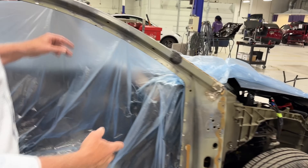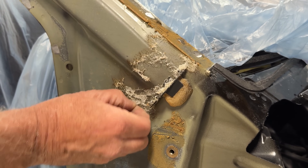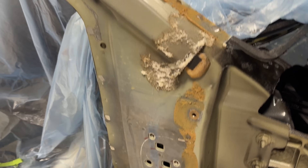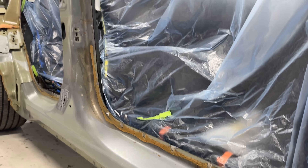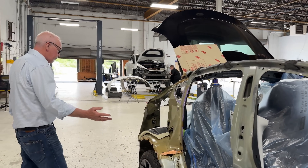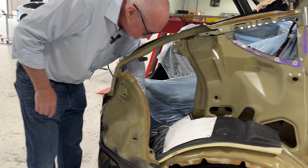Going forward, we'll see a different kind of foam on this car too. This is an open cell foam that's been removed from the vehicle right here — a different type used in this location. You'll also notice this sort of brown foam that runs all the way through, visible in many specific places throughout the vehicle. This foam is also an NVH foam used to keep the vehicle quiet on the road.